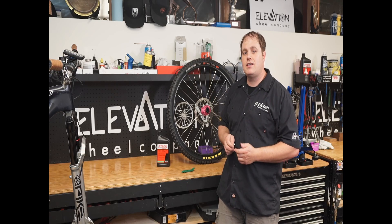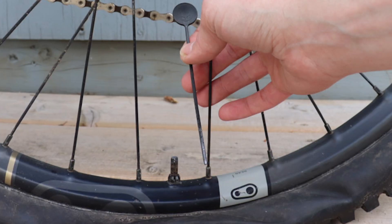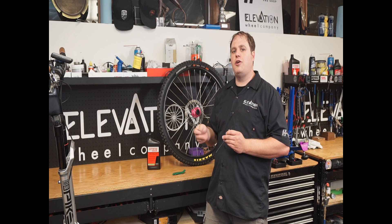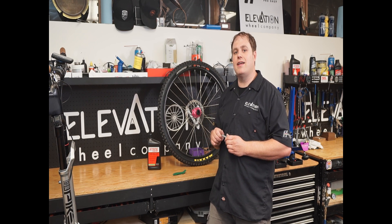There are a couple ways you can check your tire sealant. The easiest is to use a dipstick — either a commercially available one or even just a small zip tie that fits down to the valve. Another way to do it is to pop off the side of the tire and visually see how much sealant is left inside.